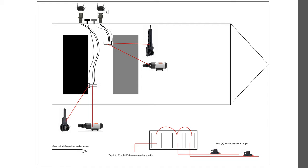On the gray tank, everything's the same except it uses a one-and-a-half-inch connection — that's what was on the gray tank initially. You could go with a three-inch if you want, but I decided to stick with the one-and-a-half-inch. Then you connect your new cable and your plumbing the same way.